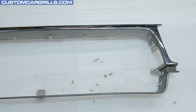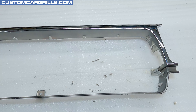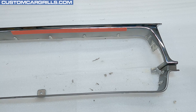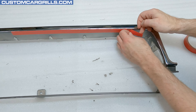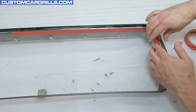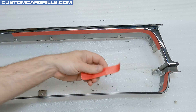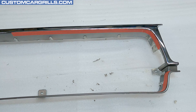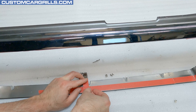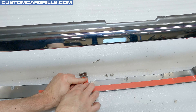I'll grab some low adhesion masking tape that's exactly three quarters of an inch wide. We'll be using this as a guide on where to trim the grill. The tape should be placed on the inner edge up close to the front face right before the curve of the grill. When we're finished, we want the leftover part of the grill to be three quarters inch depth from the front all the way around. To get around some of the curves, I needed to break up the tape into smaller sections to make it around the corner. Obviously, I'm not going to tape over the side mounting tabs — those need to stay exactly where they are. The lower mounting tab will need a little bit of trimming on the sides, so I'll mask off that area on where not to cut.